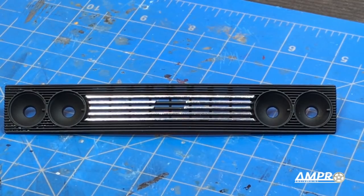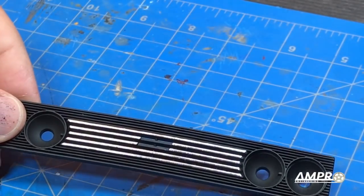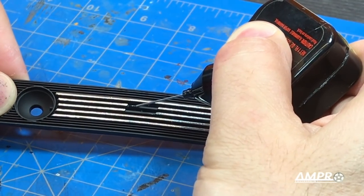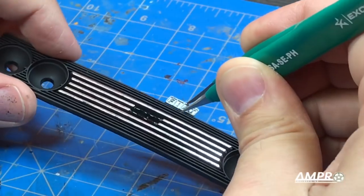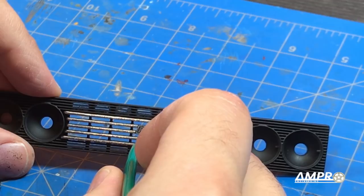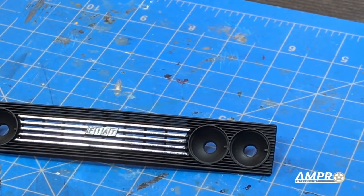The proper orientation of the grill is to have the two extra bars below the Fiat emblem — so one above and two below. I'm going to take some high quality model glue and just apply some in this recess. I'll put a little bit in between the two, then take some tweezers and drop the emblem right in place, making sure that it is even and equal. As soon as that dries, I'm going to paint the inside areas of these headlight doors a silver color so that the headlights look a little better when you put the lens on.